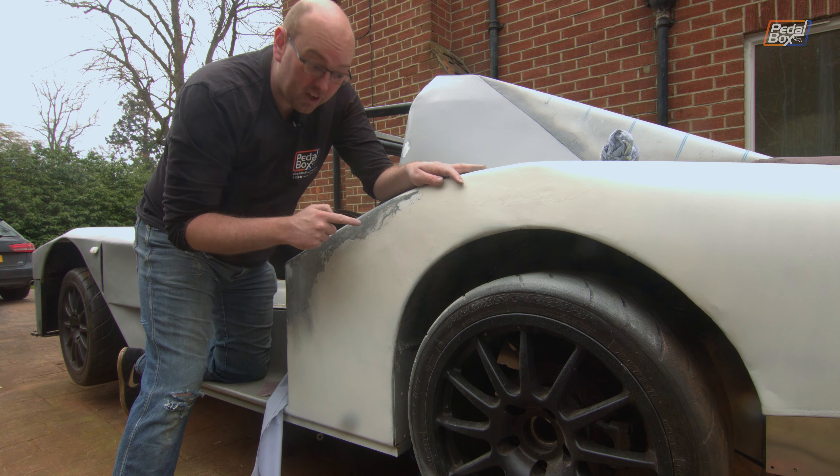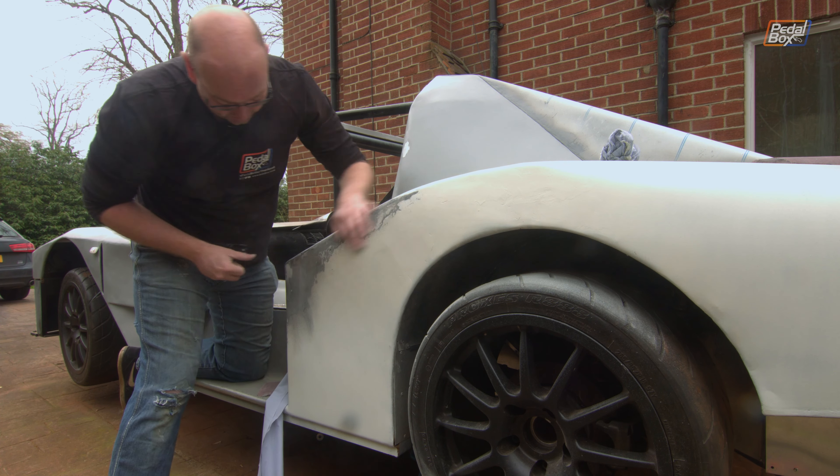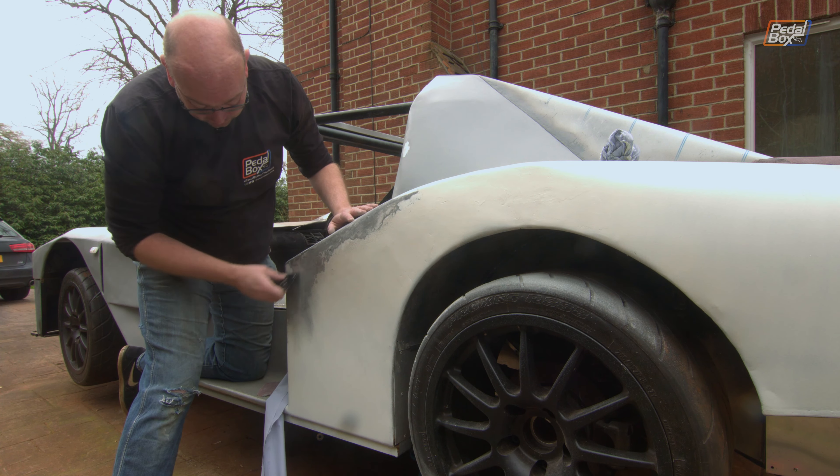Today was meant to be a really nice episode where we just rub down the back of the car and actually put a bit of paint on it so that we would stop chasing our tail — going around and around — putting primer on and then it flaking off when it got a bit of moisture underneath because it's porous. So we were going to put some paint on it, put some lacquer on some parts, it was just going to be black and nice and easy. Instead we're having to do this because we didn't read the instructions — I foolishly just thought that putting high build primer on top of primer would be fine.